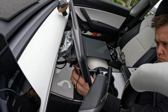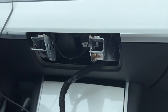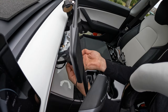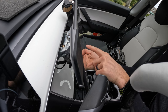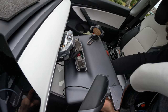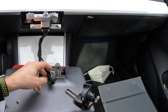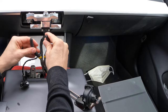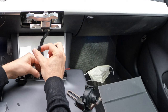Also remember that I'm removing an old mount, so yours will look differently — your screen goes straight into the car and you won't have this bracket that I have to remove first. We start out by unscrewing the two screws on the bottom, one on either side. It's always a good idea to power off your screen when doing stuff like this, but it's kind of pointless because it just turns back on every two seconds anyway. Next, I took my screen and put a towel under it, laid it on my console so I could work on getting out the connecting wire that connects it to the car's computer system. To do this, I just take a pair of needle-nose pliers, pinch both sides, and lift — it comes out very easily. I do recommend using the needle-nose pliers; doing it with your hands takes about 7,000 hours and your fingers about die.